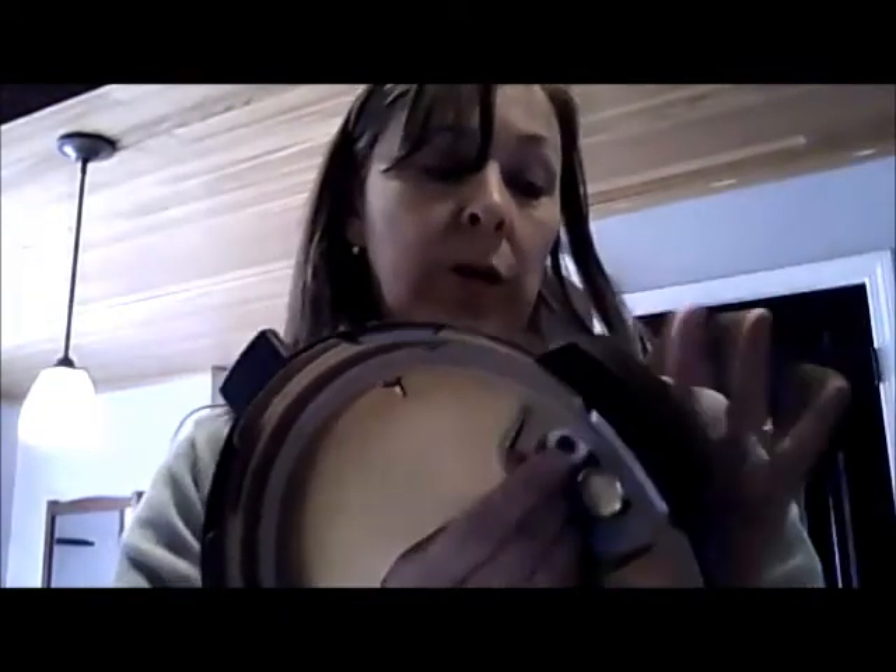That's the bottom of the vent, which is the knob right there. The other part is the pressure gauge — see the pressure gauge? When I touch it I can push it out, and that's how I know when my pot is pressurized. There is a tiny little silicone seal on the back; if you take that silicone seal off, this comes right out. It's really not very complicated — you can take this whole thing apart and clean it. Sometimes it's easier to get this one off once you have the other one off. I don't want to yank it, though it doesn't hurt it to yank it. I'm putting my little seal back on my pressure gauge and I can see it still goes up and down the way it should.